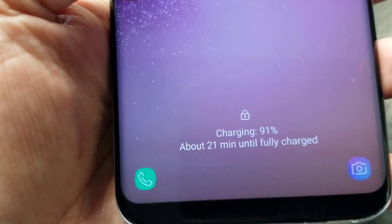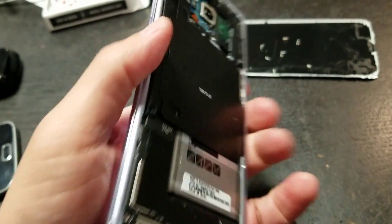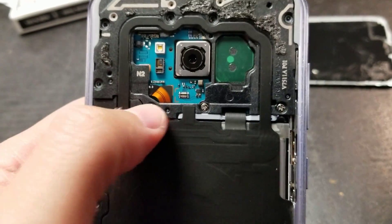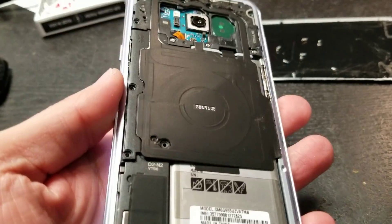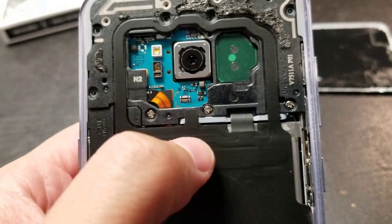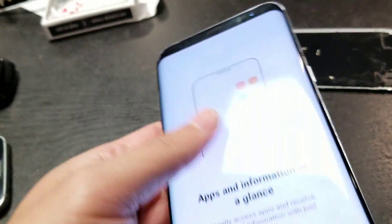You see how it says fast charging? It's fully charging now because I have the screws screwed in right here. So if you're trying to repair a phone and the customer's phone doesn't charge, it's because this wireless charging pad has to be screwed in — it affects the charging.